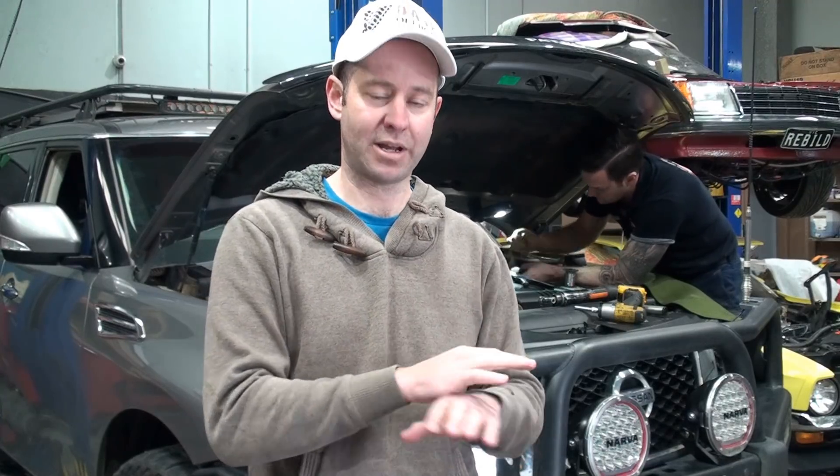What happens if you're out in the bush? Let's say I flash tuned it and something goes wrong, engine lights are on, it goes into limp mode. With a flash tune, you can't do anything about it. But if you've got a Unichip, you disconnect it, you put a bridge connector, and that'll change it back to the factory computer as if it never happened. Because these chips aren't bolt-on as such — they're actually like a whole ECU kind of management system. They're closer to that than a typical chip that you'll see.